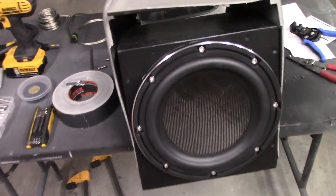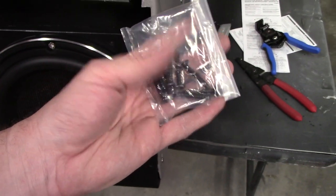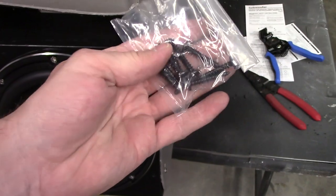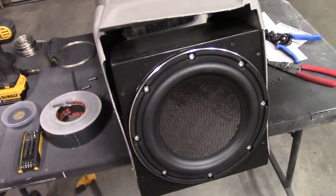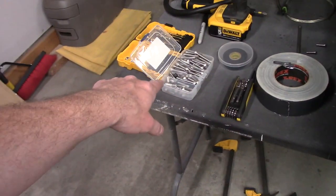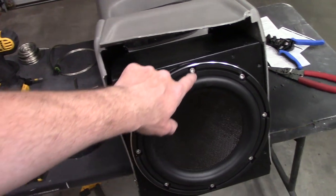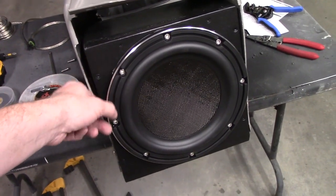I had to over drill. Again, I don't like that it comes with wood screws. And you can do that, it'll hold. But if you ever have to dismount this or you ever want to replace it, it's much better to go with some of those wood inserts and some M6 cap head screws. So they're all in there, nice and neat, more machined type attachment.